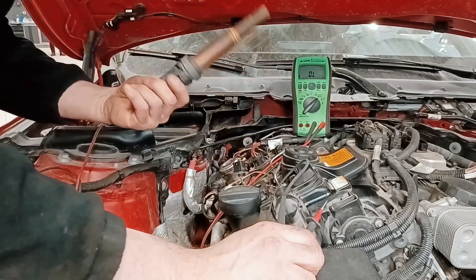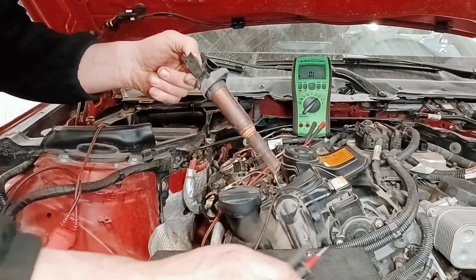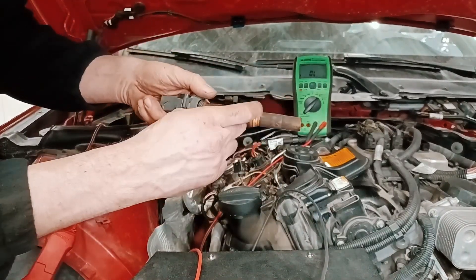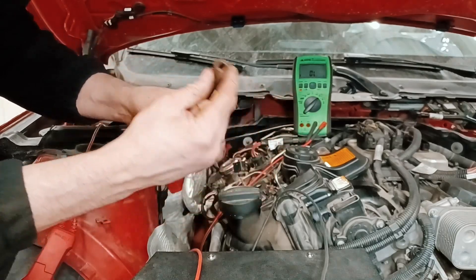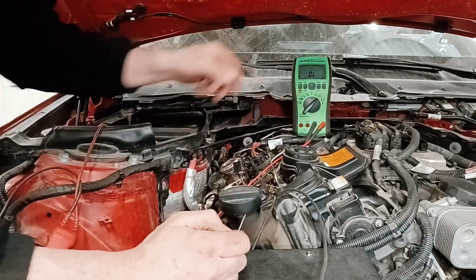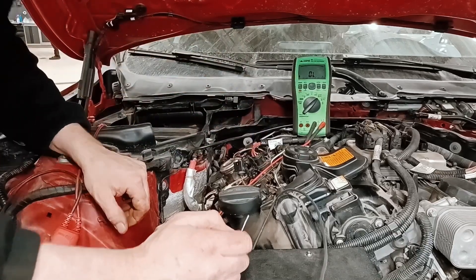We've just got a knackered transistor — but the coil could have caused that. It does stink a bit, and what happens is people do the injectors and get fuel in there; it's probably had some fuel on it, or something that varnished, and it just shorts out and knackers the transistor. So we'll change that coil as well because I don't like the idea of putting it back on. And that's it essentially.